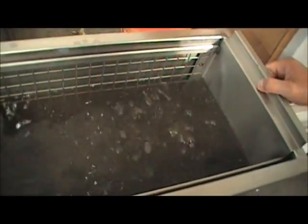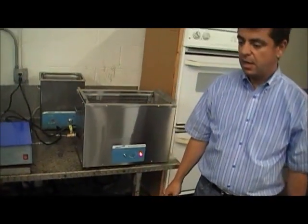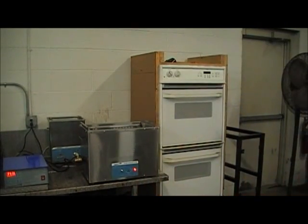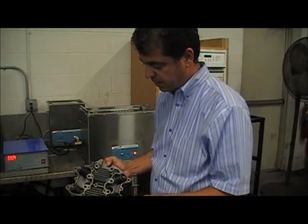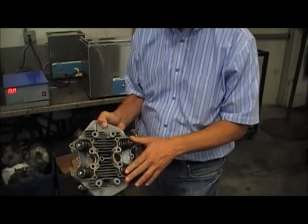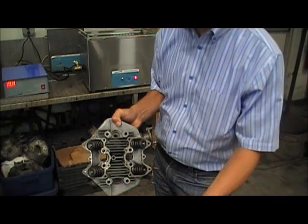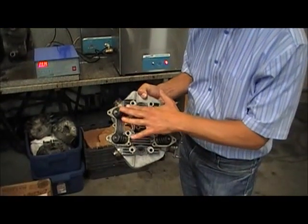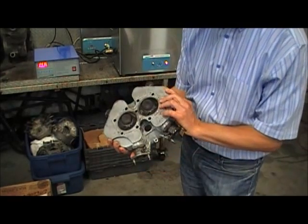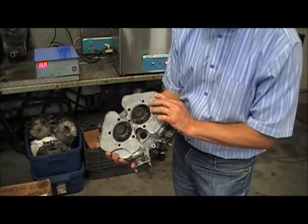I'm going to keep them in there for a couple of minutes and then see what they look like. We cleaned it for about 7 minutes — normally a cylinder head you want to keep it in there for about 20 minutes to remove everything. But in the first 7 to 10 minutes you should take it out and look at it. You can see this was totally rusted here — I cleaned it up and the bottom looks pretty good for only 7 minutes of cleaning.